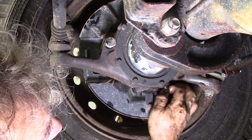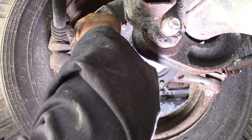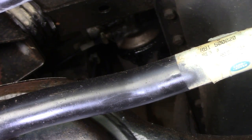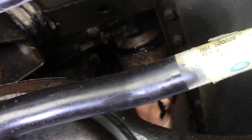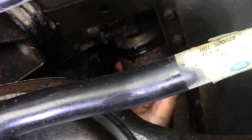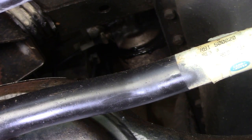That's why it hasn't leaked - we'll put the bungs back in and check the other side. The next thing is to change the oil filter. I've backed it off but I let it drain into a bucket first because there's a bloody pipe right next to it - a return pipe from the breather which makes it difficult to get off. The pipe goes right tight round it - what a daft idea. I'm going to have to take the hose clip off the oil return line to get it off.